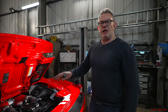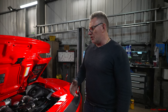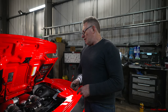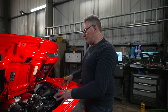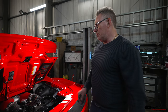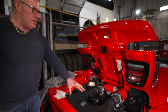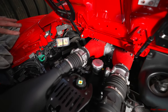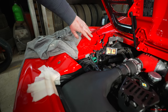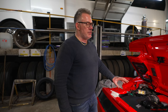I've checked the Forza unit - when you switch ignition on, the light comes up on the Forza unit, so that's fine. It shows it's interconnected with the 458 wiring loom and taking power, so it should function okay. We'll fire it up once the air filter box is back on. We've got the car back together - air filter box back in, air filter lid back in, throttle bodies reconnected. All the Forza controller unit is wired in, cable tied nicely, all hidden away, and all cabling runs along the natural route of the 458 cabling.